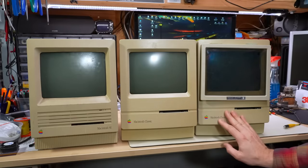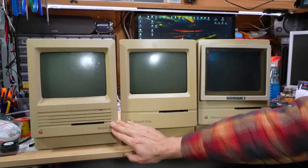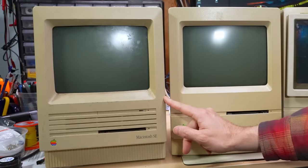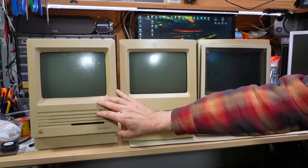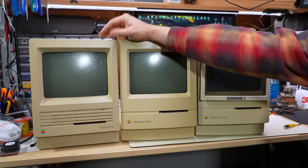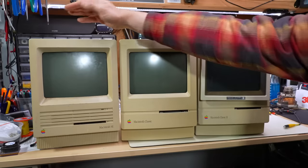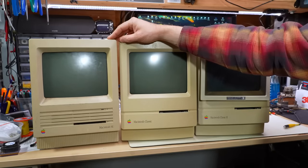Looking at these three machines, how likely are they to actually work in this rough state? The Macintosh SE is definitely one of the most reliable of the classic Macintoshes. The 128, 512, and Plus are similarly reliable, but the SE has the benefit of both internal and external SCSI, while the Plus only has external SCSI and those earlier machines don't really support hard drives at all. Mac SEs are relatively inexpensive compared to the SE 30, and the power supply is a very high quality Sony unit that generally works all the time.